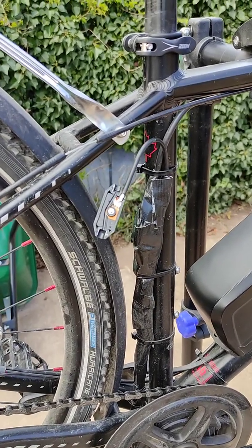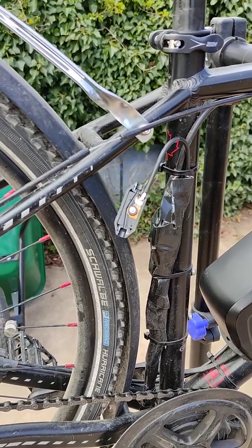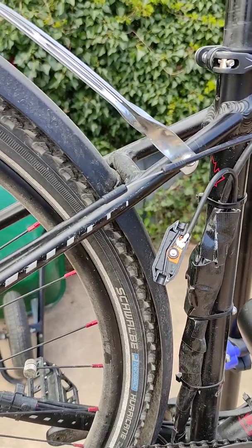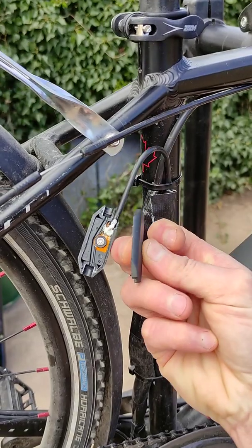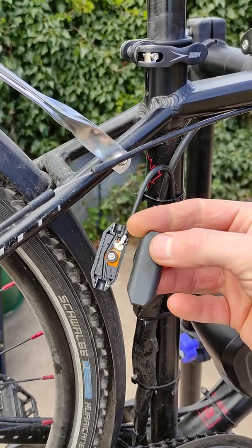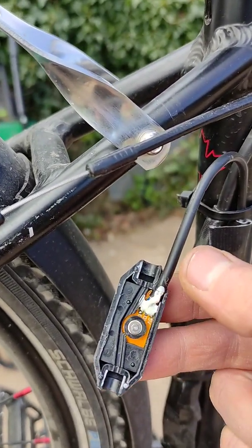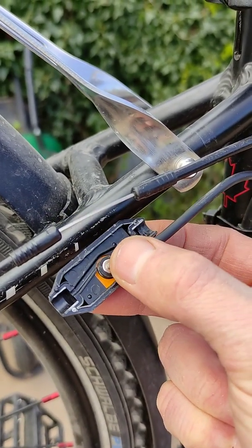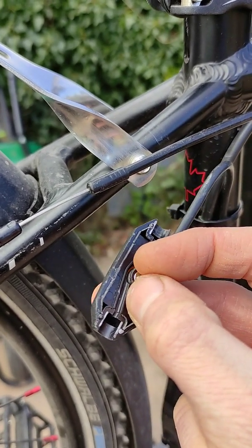It just hadn't been used for a month or two. The bike came to use last weekend and it wasn't working, so I deconstructed it. There's no way it's supposed to be dismantled — this was the cover on there and I simply had to go around the edge with a sharp knife and then it came off with a little bit of persuasion. It's a pretty simple device really: the cable normally comes in, runs across over the pulley and out the other side, and that pulley is supposed to move.